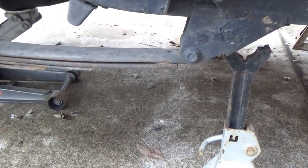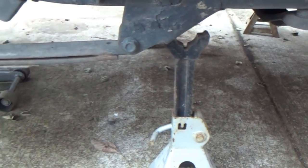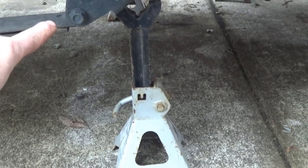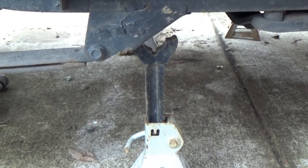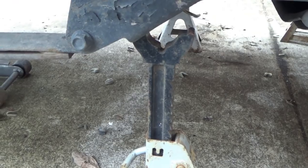And being that this rig right here sits a block taller, my jack stands aren't tall enough to reach the frame. So we've got the 35s pulled off on the rear, and we're gonna set this down slowly on the jack stands. Because the engine is up front, the balance should keep everything stable. So we can go ahead and slowly set it down. Let's watch the jack stands.